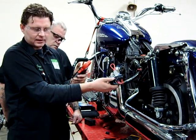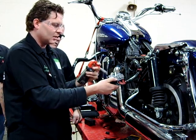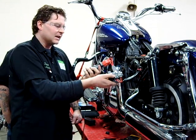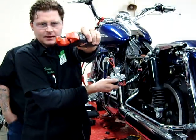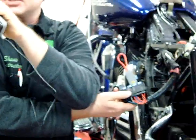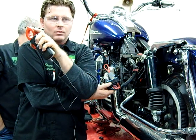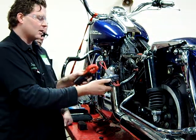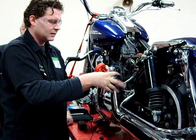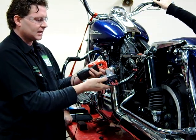I need to make sure it's not pinched on the wire. If I don't have this all the way shut, you can see the piece of metal inside the probe — that makes the connection. Even on the dyno with a tach signal, if you don't have it fully shut, the tach signal won't work and we'll get falsified readings. Make sure it's all the way clamped. Go ahead and fire up the vehicle — we're going to see what amperage is coming across this battery fuse.